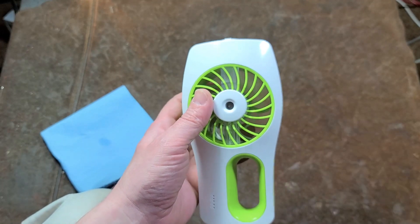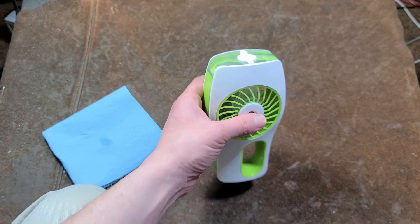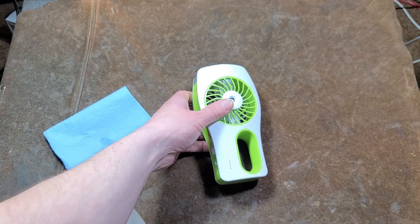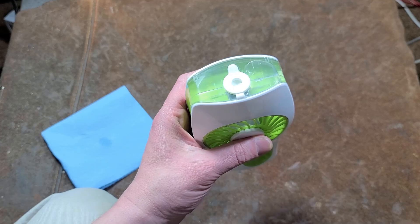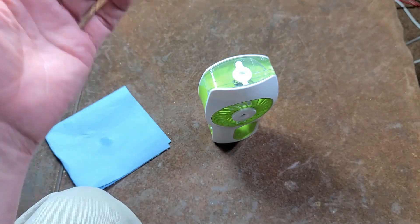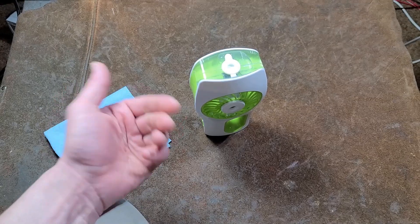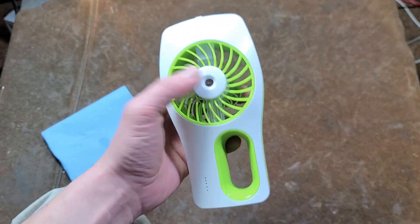The idea is that you get wet as the water evaporates — it requires energy cooling you off, and then the fan assists that. The fan's kind of weak. It's like one of those fogging machines, like those little desktop Zen waterfall things — that's about the power of it. You need a big battery and a good fan to actually keep you cool. If you're going to swamp cool, which is what these water-based coolers are called, they make giant ones — Napa Auto Parts and those places sell huge shop-sized versions. But they work a little differently; they have panels which are kind of like filters that run water through them, and the fan blows through those panels to give you high-humidity cooling air. They just need a lot of water, and something like this doesn't work.